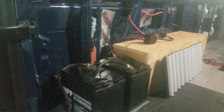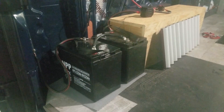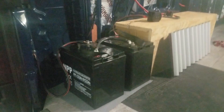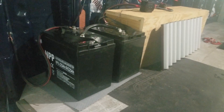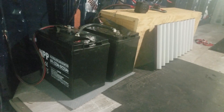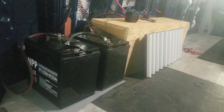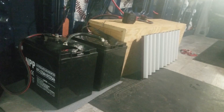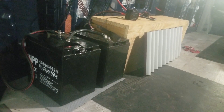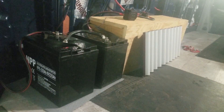We'll be tying in a 2000-watt inverter. The batteries will get discharged by all those things throughout the day. These batteries can safely cycle down to 50% of their capacity — they say 30%, but 50% cycling is about as much as you want for a long, happy life. Unlike the van's starter battery, which should never get cycled down more than 10% — those want to stay full and get charged constantly by the alternator.